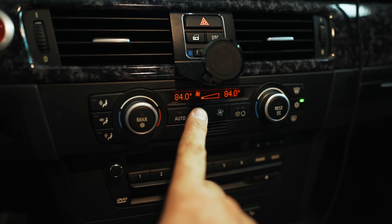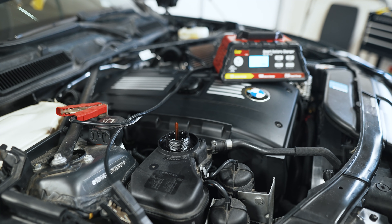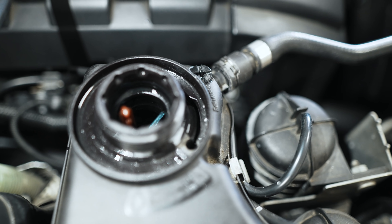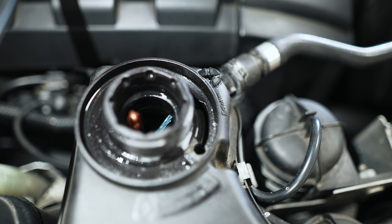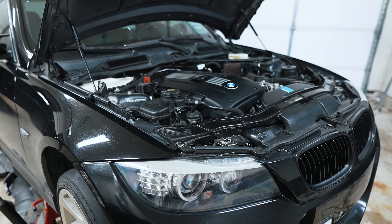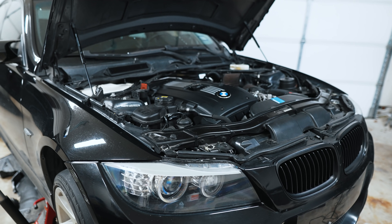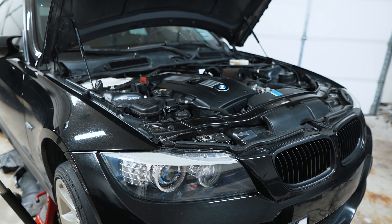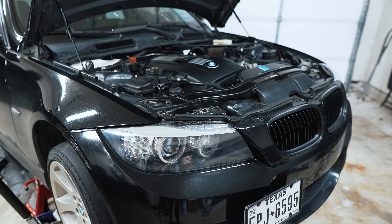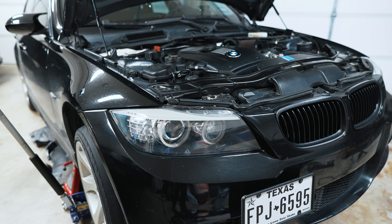I set up a battery charger running at 25 amps so I can run the bleed procedure. Make sure your headlights are off, key in the on position, put the temp all the way to 84 or all the way up, fan on its lowest position, and just press the accelerator pedal for 10 seconds. This will take about 10 minutes or so, then we'll top it up. The bleeding procedure is done — no leaks, everything bled properly. If this is the first video you're catching of mine, please consider subscribing, and if you liked it please give it a like.